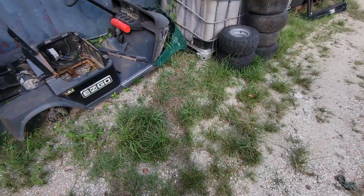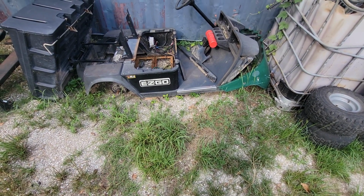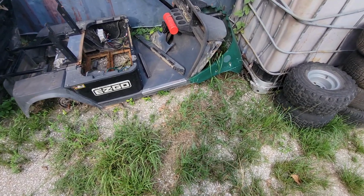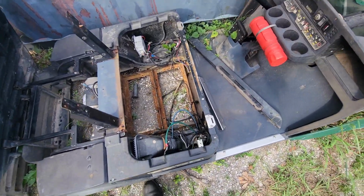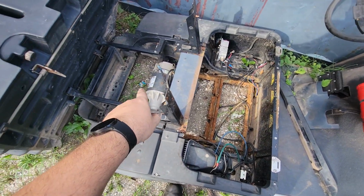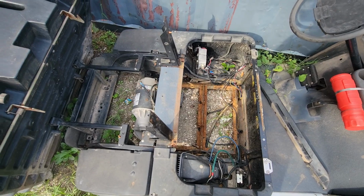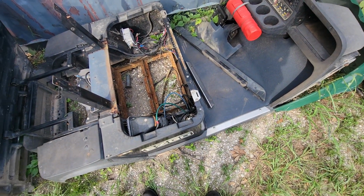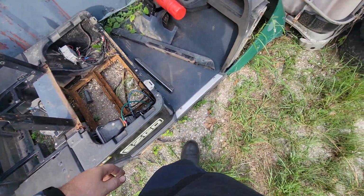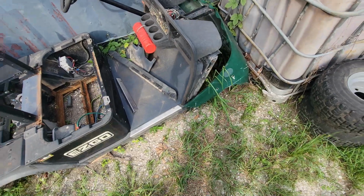See, spare golf cart parts. Technically not mine, but it was too much money for them to repair it because all the electronics were gone. The thing was flooded, so it had a bunch of good spare parts on it. It's kind of a shame. Personally, I would fix it up if I could get the parts, because I know the controller's shot, the motor is shot. Otherwise, it's in fair shape. It needs a bunch of spare parts now, though. Needs the springs for the rear axle, some bolts, a seat, and all the steering components. Those might have gotten borrowed for another machine. But good frame.